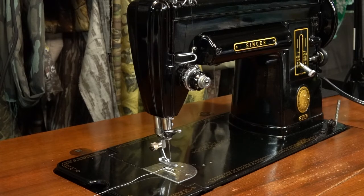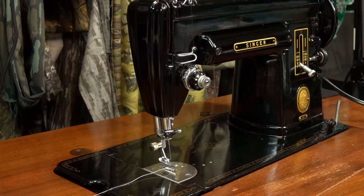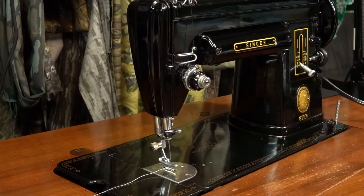I put it into the machine first, then applied the grease to the worm gear. I applied a little bit of grease to the hand wheel gear that it meshes with. Greased the two gears at the top, greased the gears at the bottom. And then I just went through the oil points with regular sewing machine oil, and it's been working very well.